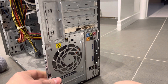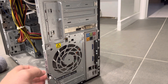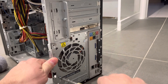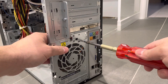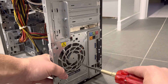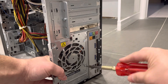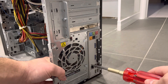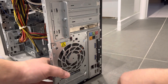I'm going to remove them as you can see right here. Once I get to a certain point it might be easier to remove them with my fingers, but at this point it's easier to just continue using the screwdriver. There's two of the four. The third one is being removed right now — actually let's remove the bottom one first. It's easier to work with the fan hanging from the top screw. If it's hanging from the bottom screw it might rotate to the side; hanging from the top screw it'll likely just hang there. There's the third screw.